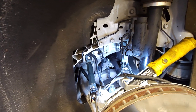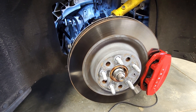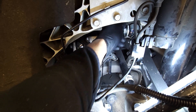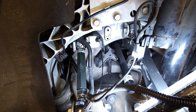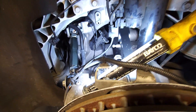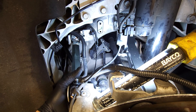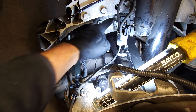I'm setting a baseline for toe and camber adjustment just to get to the alignment shop — the alignment shop will do the final setup. Important torque specs: the camber arm rear bolt is 103 ft-lbs using an 18mm on both sides. The lower bolt is 15mm at 96 ft-lbs. For the toe arm, connecting to the subframe it's 85 ft-lbs, and connecting to the rear knuckle of the wheel assembly it's 95 ft-lbs.